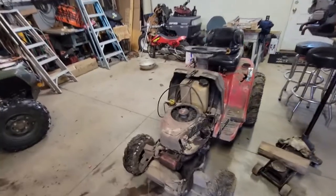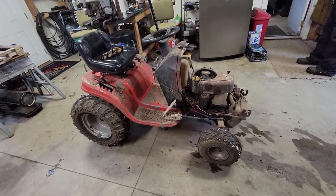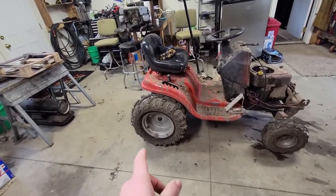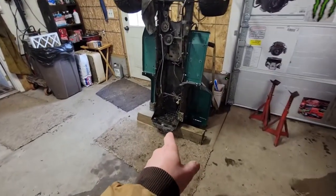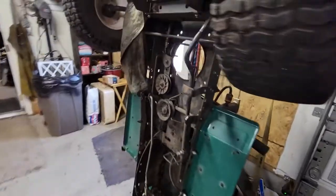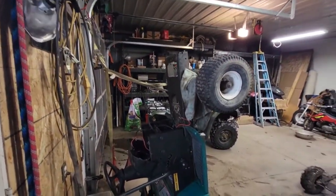We got them up to the front garage. Got the hood off Tater Tot — more or less it's going to get stripped down, get all the pieces we want off it. Get the motor rebuilt — just the head gasket should be the only issue. Probably check the valves while we're at it; make sure the valve lash is good. The 820 is going to get drained, get the locker kit in it, Permatex it, oil it up, make sure it's vented. That will mount right in here — this already had an 820 on it so it'll bolt right on. We're going to have to modify the clutch to work — this will be way too close — but this is what we have to work with so far.